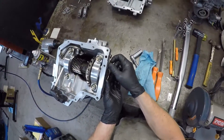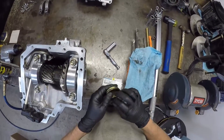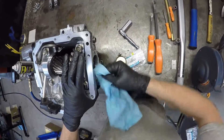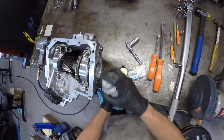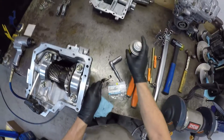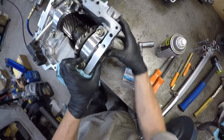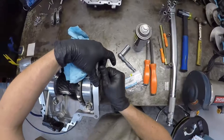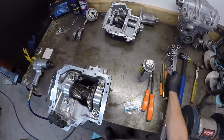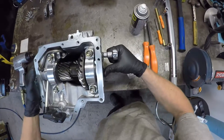Your side cover seal — there's an O-ring right here. Pop this cover off, it's 10 mil. Take the O-ring out of your package and install it. Give it a quick little spray of silicone spray, then just walk it in gently and snug it down.